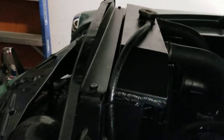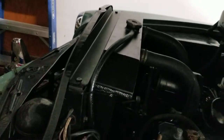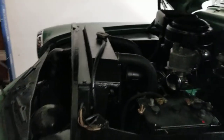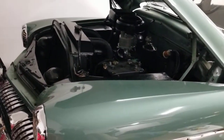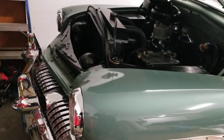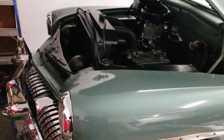The temperature went up to 225°F right away, and then I realized what was going on. I made that angle iron air dam, and that solved it. But buyer beware — it's a good value, but if you have to do that kind of modification, it might not be what you expect.